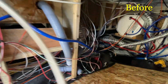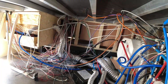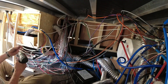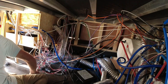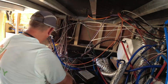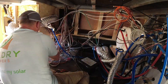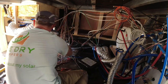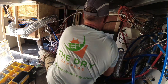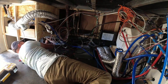This is the before. As you can see, we have quite the wire management task to get accomplished on this front living room model. Because it's front living room, there are no walls above the basement for a lot of the wiring to go to, so they have to run things a little bit differently. From the electrical panel, which is basically straight in front of me — the square box there — going to the left, that is where all of the low voltage wiring goes. It's kind of a split between what goes up to the roof and what goes under the coach to the light switches and lights. I even had to move a lot of the ducting and redo its placement as well.